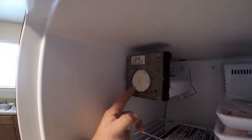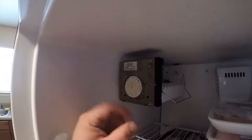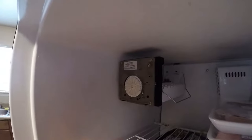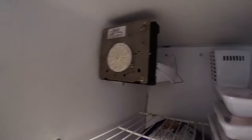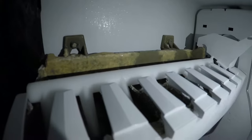As you can see the module is starting to turn, which tells me this ice maker is good. There was a click which gives me the opportunity to remove that wire, and we're going to watch it produce some ice. Right now the fingers on this ice maker are moving. There's a heater below here that actually heats up the ice that's in the ice maker, so these teeth can scoop that ice out.